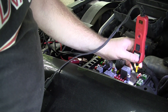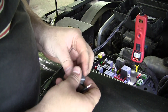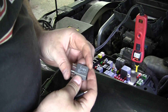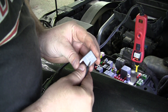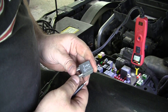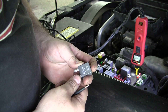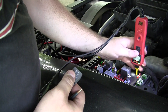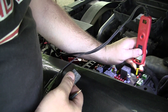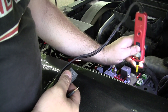That's really odd — I've got power. That would be pin 87. So it looks like if I send power to this one I could actually make the AC clutch engage, so I'm going to try that. I get nothing — I hear nothing going on down at the compressor.